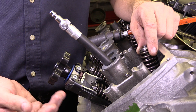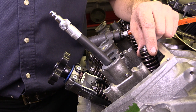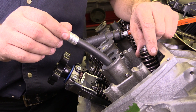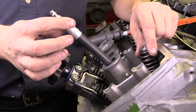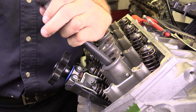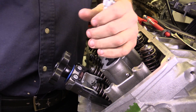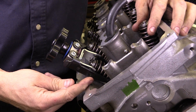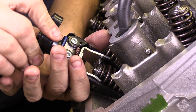So far what we've done is we've taken off the cylinder head cover and removed the rocker arm assembly. I've got a tool installed here in the spark plug port — this can just be taken from a compression tester or a cylinder leakage gauge — and the reason I've installed that is I need to supply air to the cylinder. I'm pushing air down into the cylinder and that's going to help keep my valve up against the top of the combustion chamber, or the bottom portion of the cylinder head.